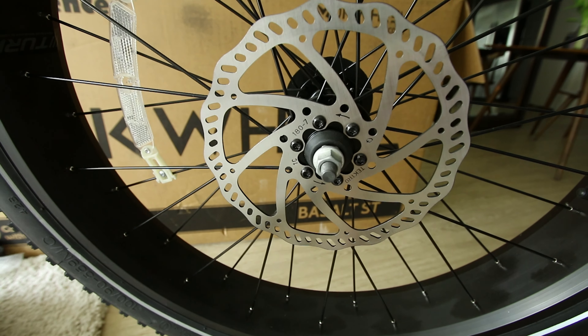Let's try out the suspension — it rotates through about half the length of the adjuster through all the settings. We'll leave it on the softest one since we're not doing any jumps. On intensity 5 when I start pedaling, I can feel that boost kick in right away. The torque sensor has a very small lag — not pedaling, then pedaling, then power — it's pretty much instant delivery. Running the bike on pedal assist 5 and intensity 5, the power delivery is actually kind of twitchy. I'm going to switch back to the default settings.